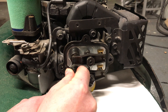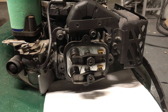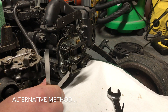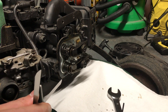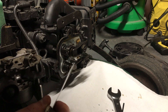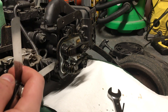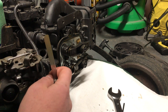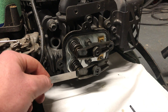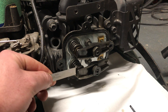Carefully lock this in place, double check — feels good. I'm going to rotate the engine for a couple of turns. I'll show you another way of checking: when the intake valve is fully open, just before it starts coming back up, check the exhaust valve clearance. And then when the exhaust valve is fully open before it starts coming back up, check the valve clearance on the intake — they feel good to me. With the engine in top dead center position you can put your feeler gauges in and there should be a little bit of resistance — not too tight, not too loose.